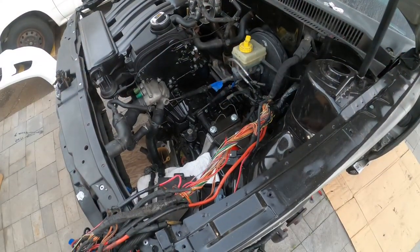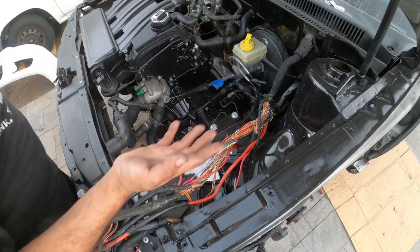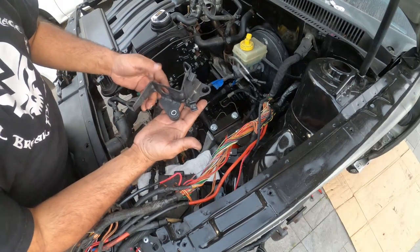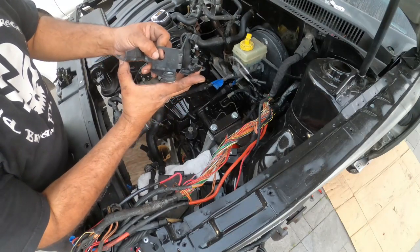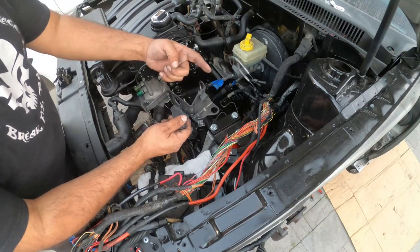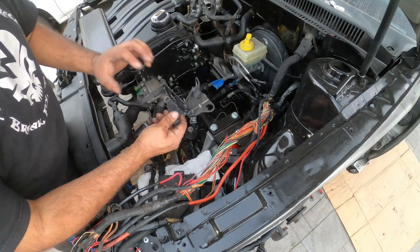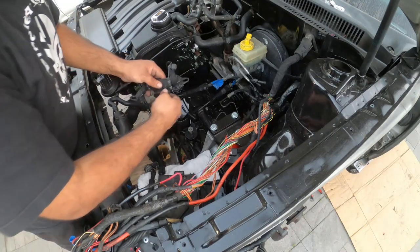All right, so we're here now in the engine bay. We install the shifter box, same process as before, nothing crazy special. First things first, we're gonna install our shift bracket. So remember, right now I only have the two metal billet ones, so I'm going to use them front and back and not the middle one. But remember, there's a back to front bracket for the shift bracket, so you got to remember that, because if you don't, you might end up putting the shifter bracket in the wrong spot and nothing will line up correctly.